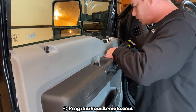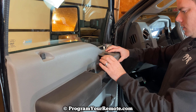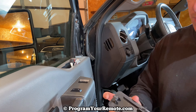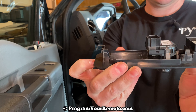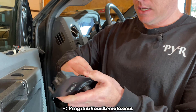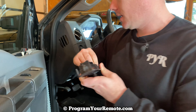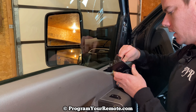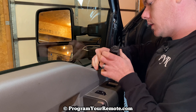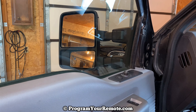All right, that's all good and tight. Now we can go ahead and put these connectors back on. These will just clip right on and snap into place. With this connector, one thing I've noticed is the clips that hold it on tend to bend. This is how it should be, and this is how it looks. So before you put it back on, bend it down — it doesn't have to be perfect, but get it more similar to the correct shape to make sure it goes in. Bend that in and connect those two connectors back on, and snap this into place.